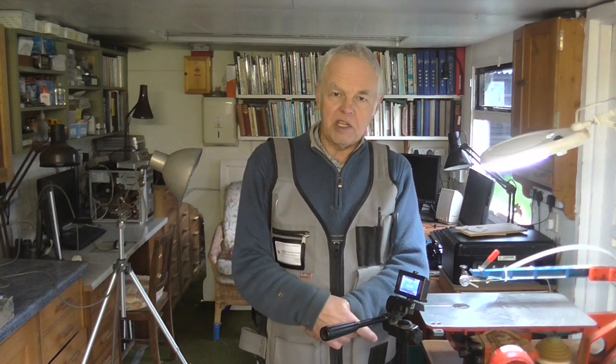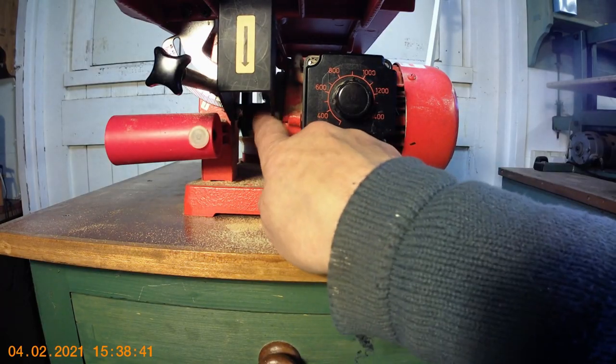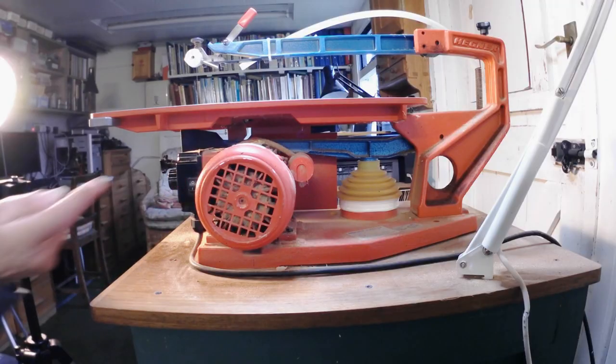If I see a machine has a carbon brush motor — commonly known as a universal motor — I'm always a bit dubious. Universal motors are very good in their place; in things like vacuum cleaners you need the high speed for suction. But a universal motor will go really fast, whereas an induction motor is limited by the frequency and voltage. Here's another view of the induction motor and the speed control down on the side.